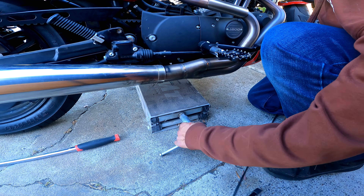We got the wheel back. I took it to get it installed at my local shop. Cycle Gear does not mount and balance tires, at least not at my location. For those wondering how to order the right tire, here are the measurements: 150/70-18. That last number is the rim size, 150 is the width, and 70 is the height. 18 is the wheel size. Now let's go ahead and put it back on.